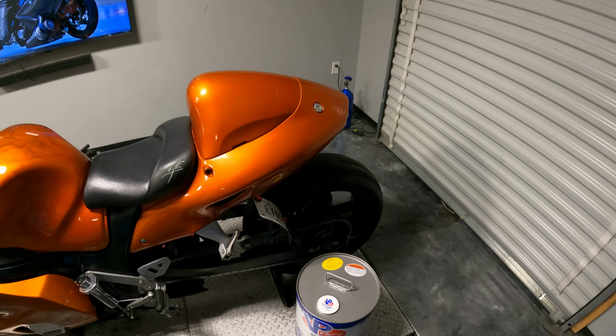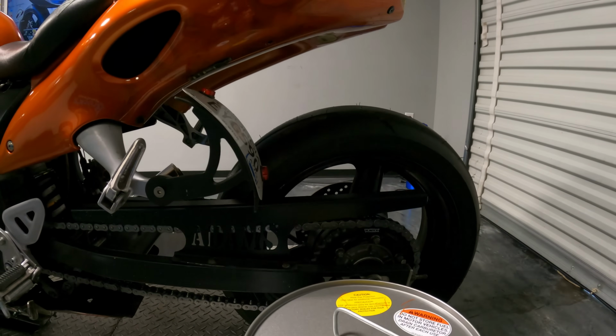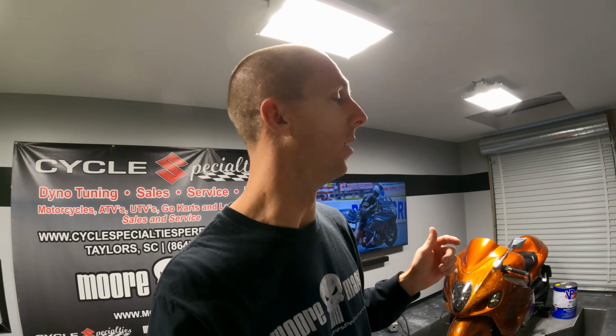One thing I want to address too before we get into the dyno and video, the tires and the dyno numbers. Okay, so I've said this a lot of times in the past, but some of you guys are new to the channel. You may be just watching this video your first time ever on our channel. So anyways, every dyno is gonna read different and every tire is gonna read different on the dyno as well. So in other words, you can have a bike with a stock tire, stock swing arm, dyno it, make 190 horsepower. You can extend the swing arm, put a Shinko hookup on the bike, which is, you know, a good modification for drag racing. There's nothing wrong with that, and lose 10 to 15 horsepower on the dyno.